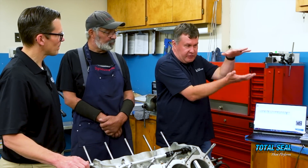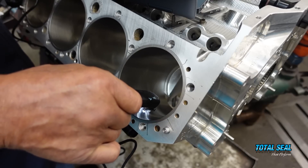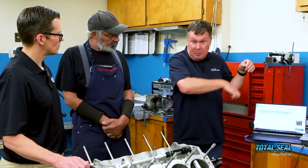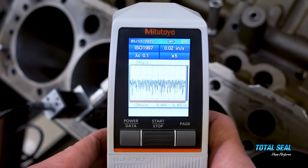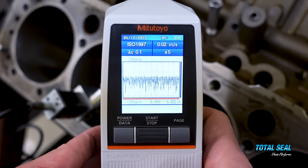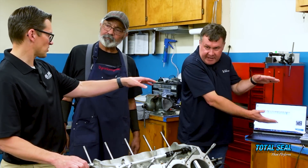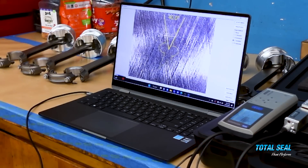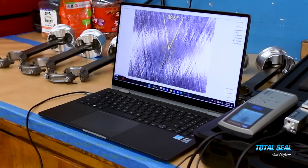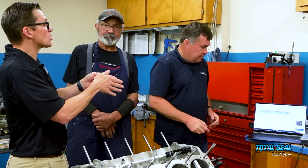This is totally blown up — we're going to stretch it out so we can see the valleys. In reality, if we were looking in there with a microscope, you'd see that the valleys are wide — much wider than they are deep. So these valleys that look like vertical lines are actually crazy wide. That's where we get that flow of lubricants. They're not razor blade slices like they appear on screen. When someone looks at a cross-hatch on a cylinder wall, those scratches are those valleys. Because of the scaling, they're all crunched together, which is why they look so steep.